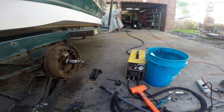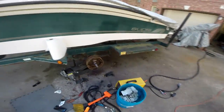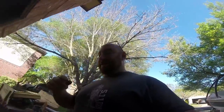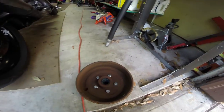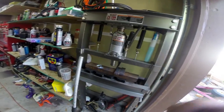I ended up having to plasma cut everything out and buy new hardware, having to go to two different stores to find the right lug studs and the right lug nuts. Unfortunately, they're going to end up being different on that side. Somebody replaced them with something else. But at this point, I don't really care. So there's our new studs setting in their holes. Now we've got to get the 20-ton press set up real quick, then we can just press those bad boys in.